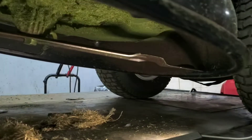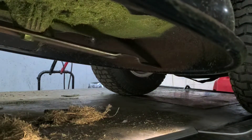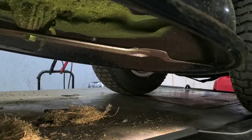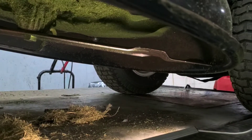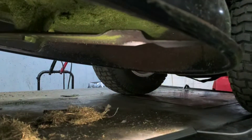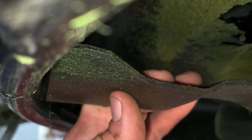The other side looks kind of the same way — it's got a couple nicks out of it, but nothing that's going to cause it from not creating suction. I always like to pick out a spot on the deck and make sure my blade is level. Pick out a piece of grass where the tip of your blade is even with the outside edge, go back around, and as long as you haven't moved vantage point, it's right there — so we know our blade is level. The backspin on the backside of the blade is what creates suction. The high-tail piece can bust off on a super old blade, but that's got to be there in order for this thing to lift.